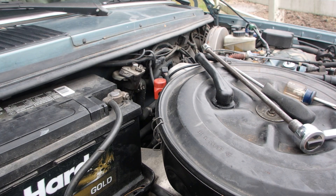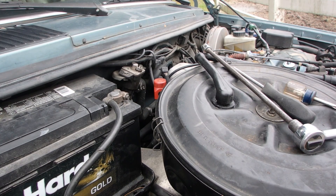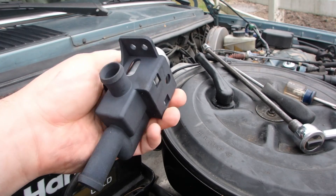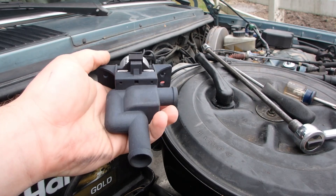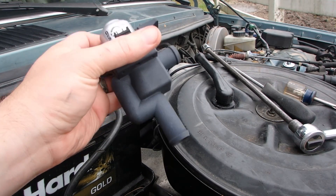I bought the Climate Design Works mono valve replacement valve, or they call it a premium replacement heater control valve for Bosch mono valve systems. It's part number BV 1.0 and it's for the W123 Mercedes. I've used some of Climate Design Works' products before and I've been extremely happy with their stuff. I am not sponsored by them, I did not get a discount — I just purchased it from their website. What it does is replace the original with an actual electric valve, which to me is an awesome product that should give us reliable heat without having to ever mess with mono valve cartridges again.